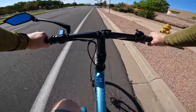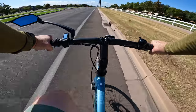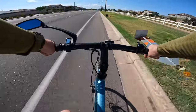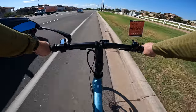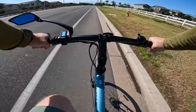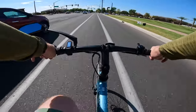Once we run out of power I'll ride around a little bit — just me doing 100% of the work — to give you an idea of how fast we can pedal without any pedal assistance. Currently at 10% battery remaining, approaching 37 miles. When you get down to about 10 to 15%, you definitely feel a reduction in power output — you're doing a little more work than at 50% or 100% battery. That's normal, caused by voltage sag: as you wear the battery down, voltage goes down and you get less power output. But it's still very comfortable to ride.